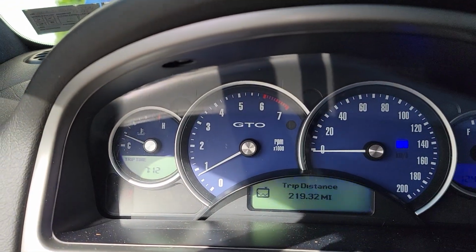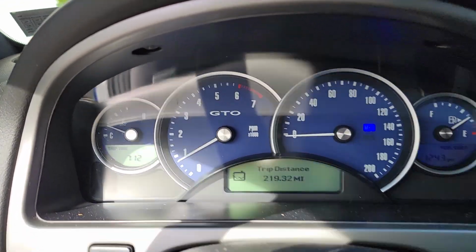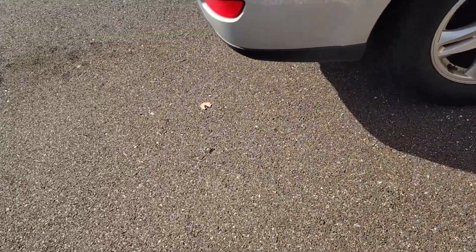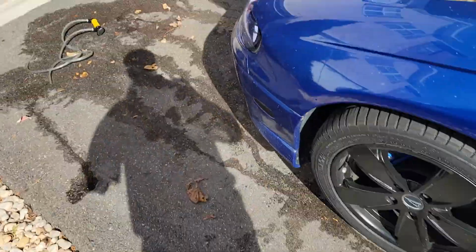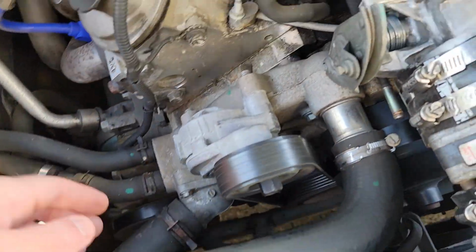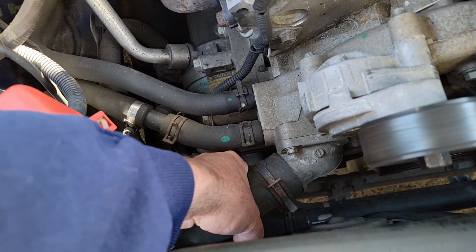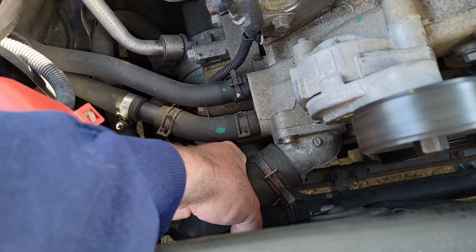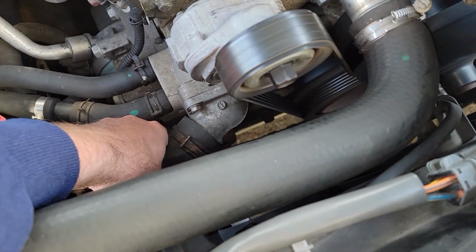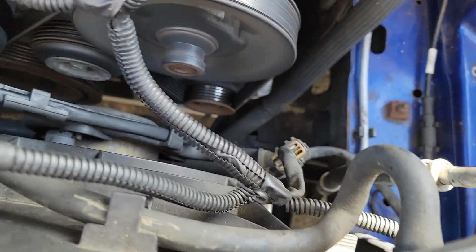So we're definitely at 10 minutes, and we're almost up to temperature. It'll probably get there in another minute or two. Let's see if I actually feel any heat now. The thermostat hose, and finally I get some heat down here, so I think that's open and flowing through finally. It feels half hot and half cold. The one side's hot, the one side's cold.